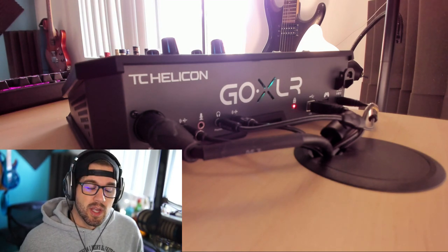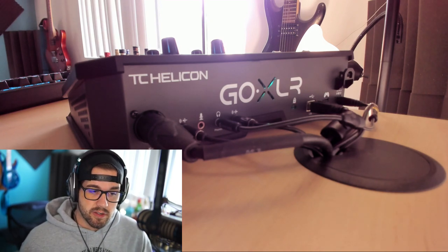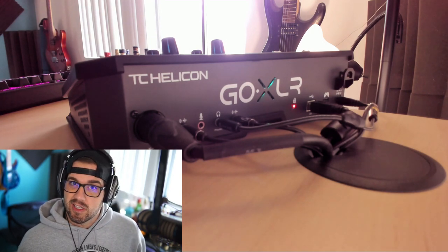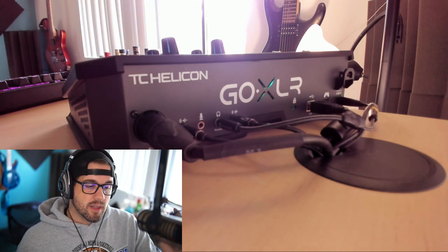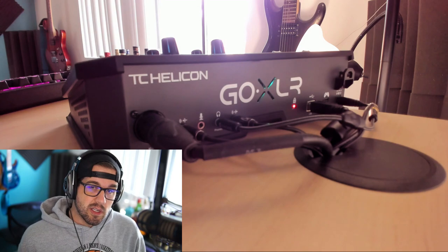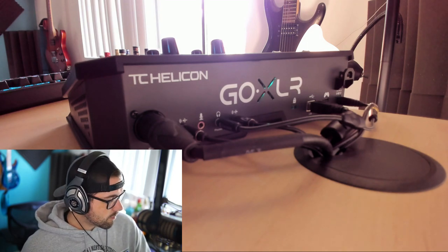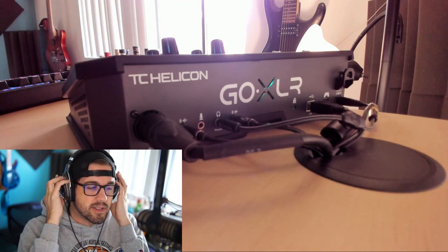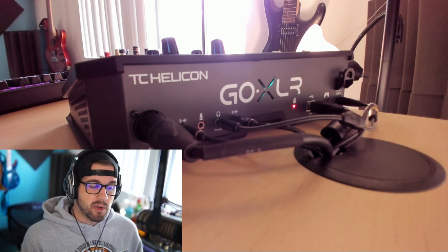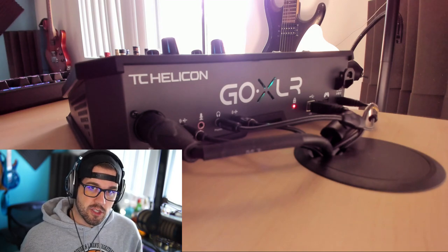I wanted to see if I could fix that. The one way I knew I could fix it right off the bat is to plug the USB directly into the stream PC and run the line outs in reverse — run the line out from the GoXLR into the game PC, which would let me broadcast my microphone into my game PC for Discord, etc., and run the game PC output into the input on the GoXLR. You can then split the motherboard output: one line goes directly into the stream PC, one line goes into the GoXLR, and I can hear my game at a separate volume than the stream. But then there was a problem — I would either have to swap the USB every time I wanted to game, or I'd have to have my stream PC on. Neither of those I wanted.